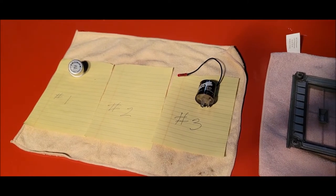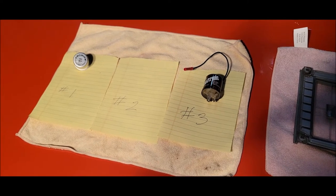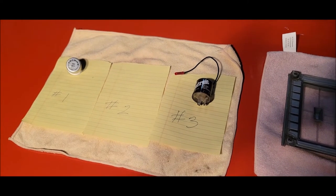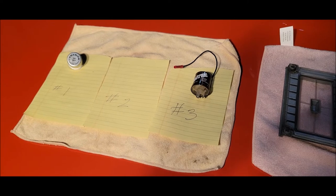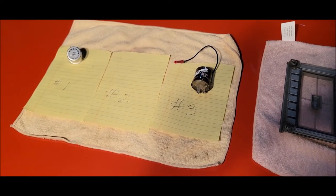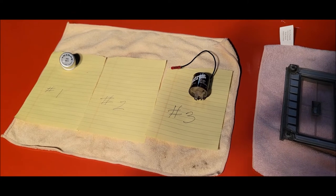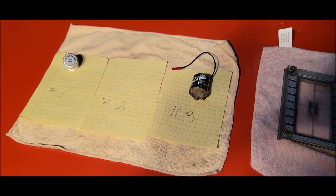So that's where I'm at. I have flasher number two in both locations. I can LED the back lights fine, but I cannot add the front lights as LED lamps. Or rather, the turn signal does not work, but the four-ways do. So there is my confusion.